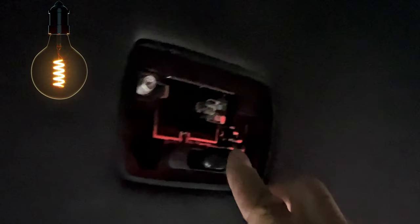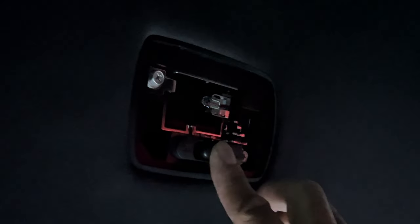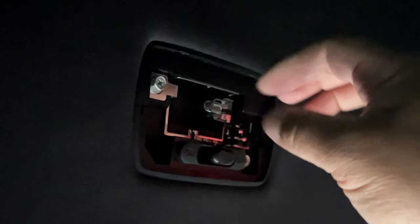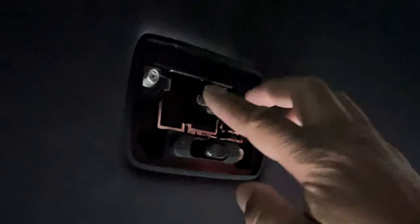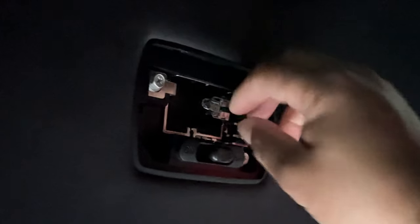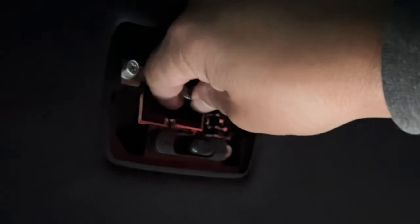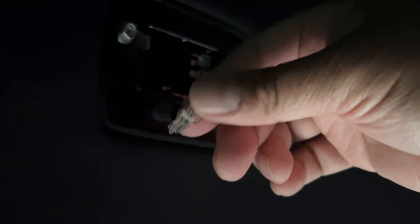All right, so now you got this bulb. I'll turn it on temporarily. All right, that's the halogen bulb. Probably you can maybe have a cloth or tissue paper, especially if it's hot, but it's okay. Even though I turned it on slightly, just pinch it, little wiggle in and out, kind of up and down, not too much, and boom, just like that.